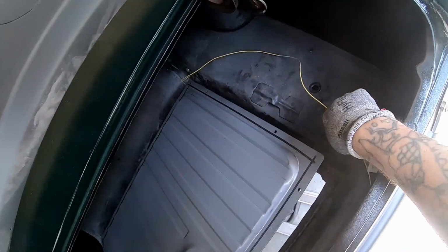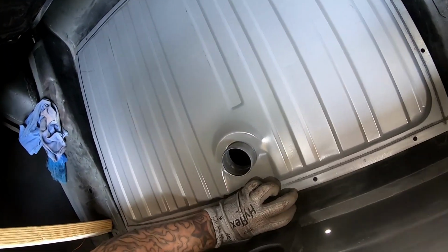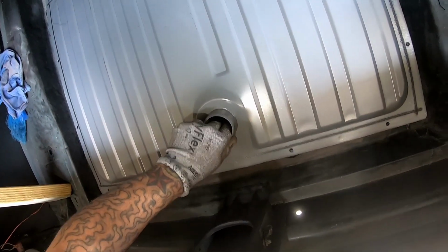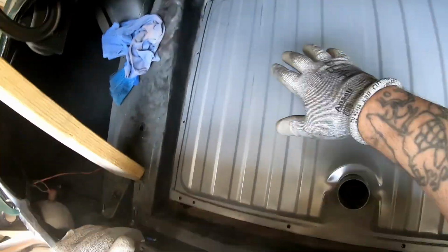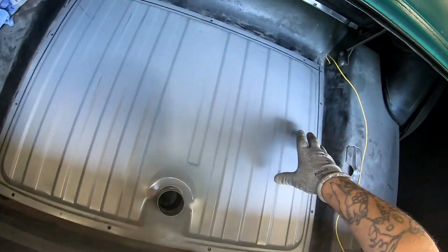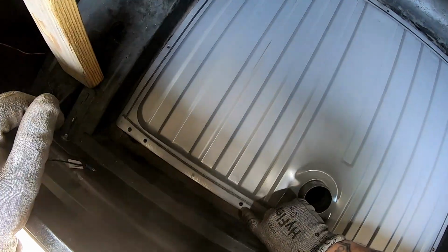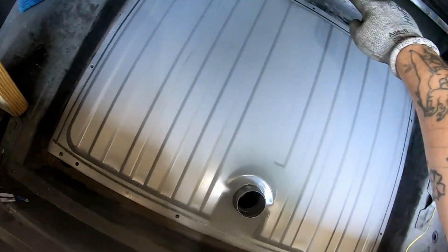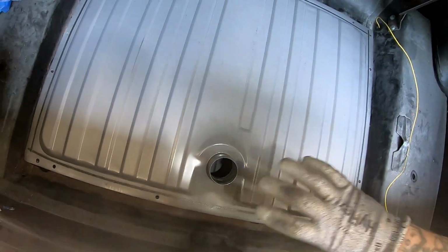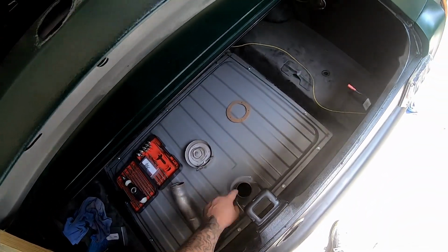It falls right in there. And then literally just line up the holes. Look at that. We have a gas tank. Cool. Now what I'm going to do is I have a kit with screws. I'm going to toss some screws in the holes to hold this into place, then we'll get the filler neck and whatnot put in. Next up, filler tube connecting to the gas tank.